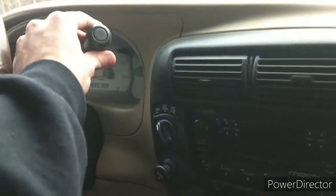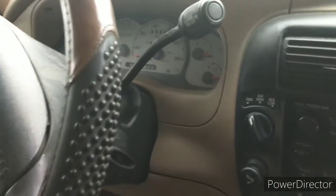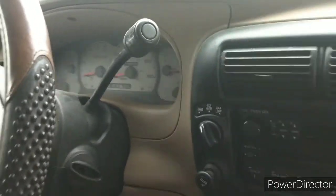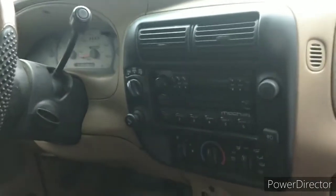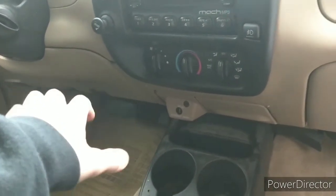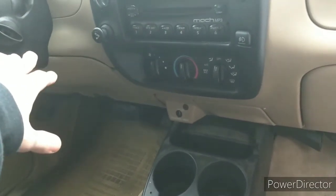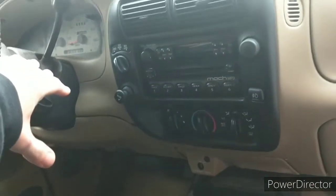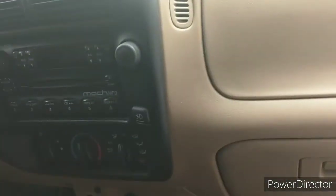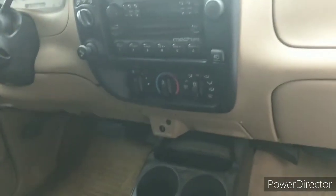I did get underneath here because this shifter is a little loose. I'll have to get under it again. It doesn't always go into park, so it won't completely start — I'll have to put it down into neutral and then it'll start. It's just two bolts, which I'll show you in a later video. They're like T25 Torx head, and I'll just have to tighten that down again, probably with some Loctite so that any vibration doesn't shake it loose again.